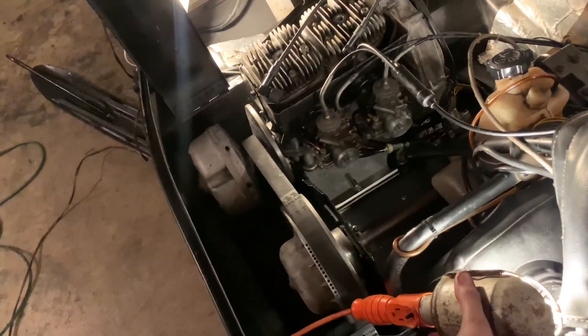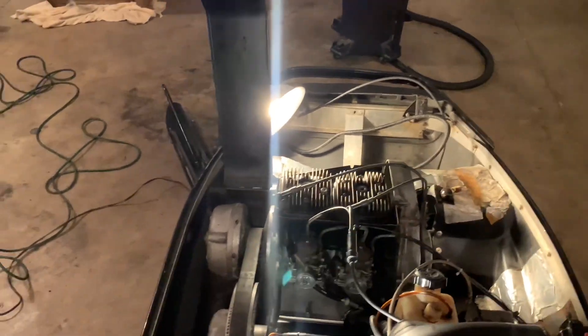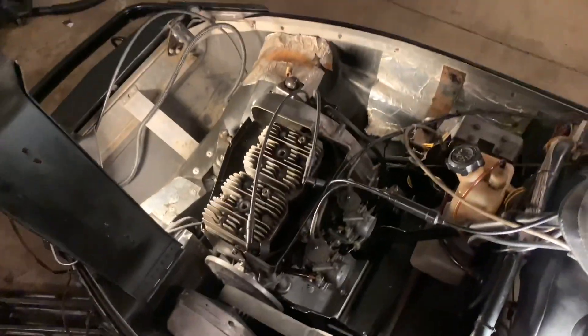I can give you a little sound taste of the compression. The spark plugs aren't plugged in right now because if you have the spark plugs in it just builds compression. I put my finger on both sides while someone pulled it and they're both popping and sucking, so all good to go — she has good compression.